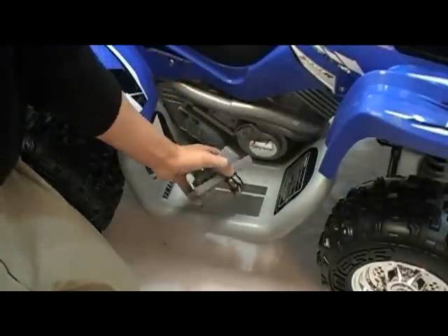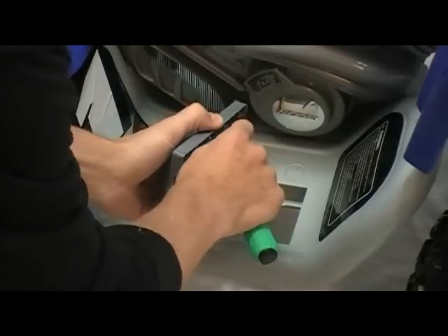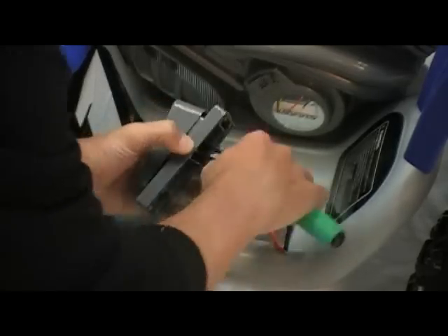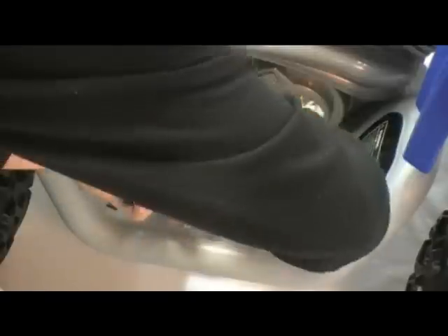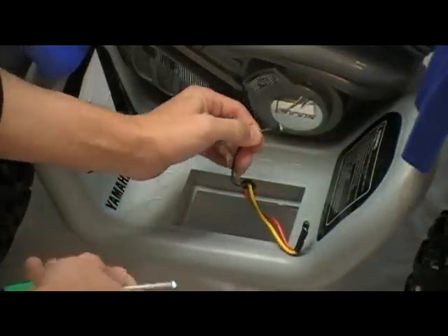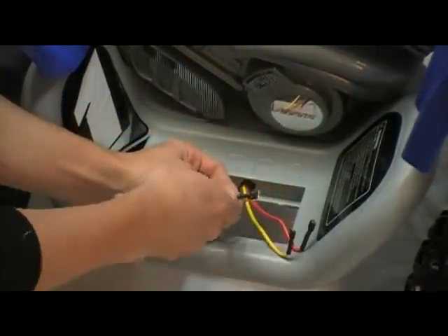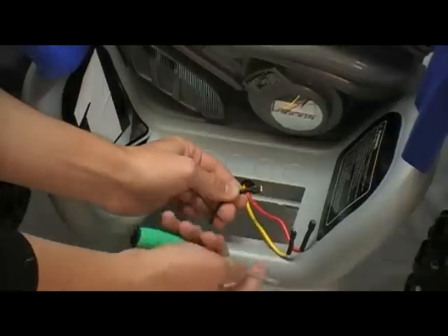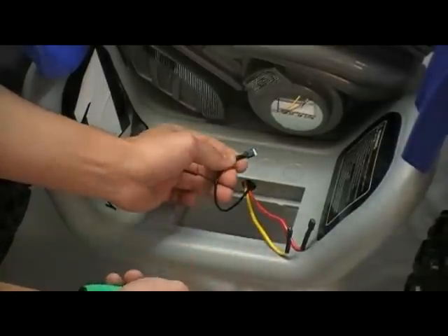Next, with your battery unplugged, remove the three wires connected to the pedal switch. There is a small wire spade located at the top of the pedal wire holding the wire on with pressure. Using the screwdriver, you can press in this spade and it will release the wires.